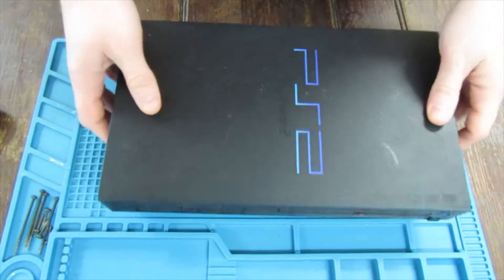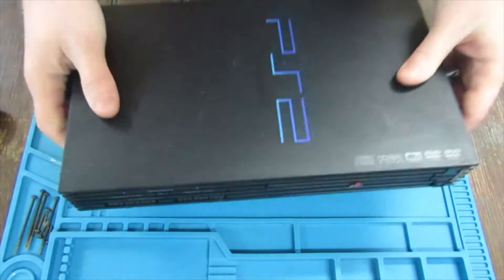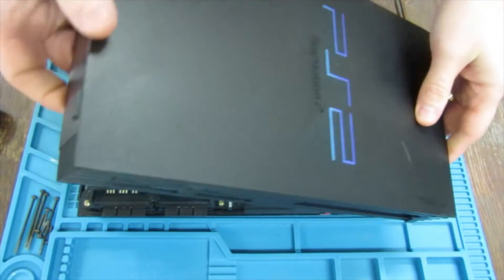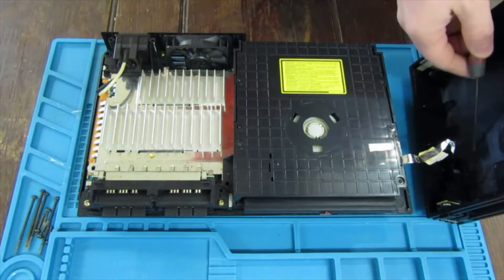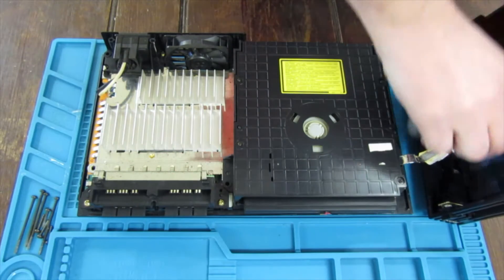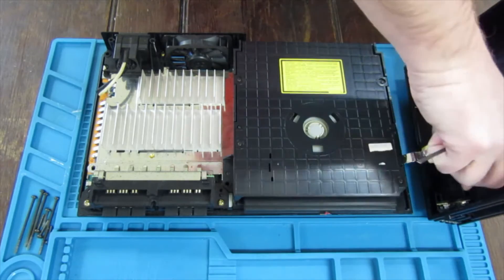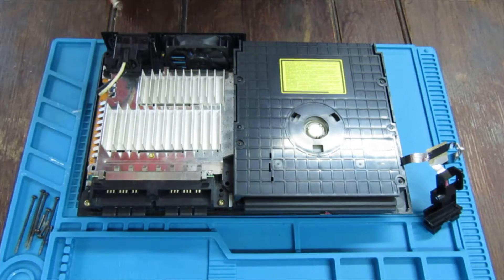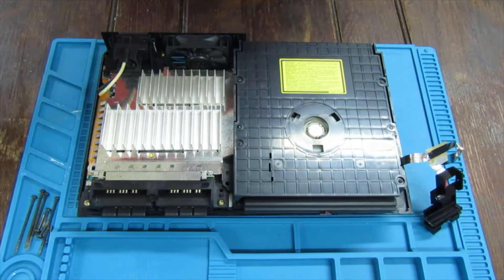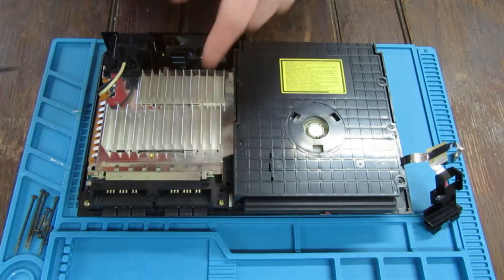This fuse is buried in the console. I've taken the screws off this console just for speed, but this one's in the bottom — simple enough under the lid covers. Undoing the lid of the console, just be careful because the button is over here. You want to go just so it pops out. Next part is to remove all these gold screws — one, two, three, four gold screws.